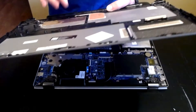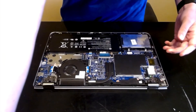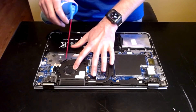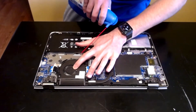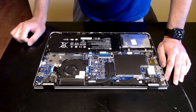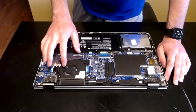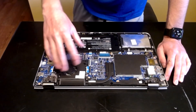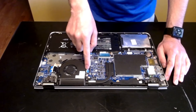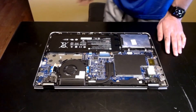I've already checked this part of the case and it looks fine. Going in here, it doesn't look like there's any dust buildup, so everything looks good on that part. I'm going to take some canned air and lightly blow on everything. I'm going to hold this fan while I blow in here to not cause the fan to spin and mess anything up. Also, before you go playing around inside a computer, make sure that you're grounded so you don't shock the motherboard or any other internal parts and cause further damage.